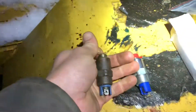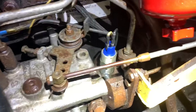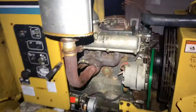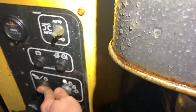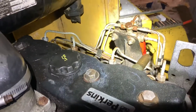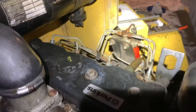So now just swap those out. I'm going to put the new one in and see if that fixes it. The new one is installed, got the injectors cracked, fuel pump is plugged in. Let's see if we got some fuel shooting out. Just tighten up all the injectors.